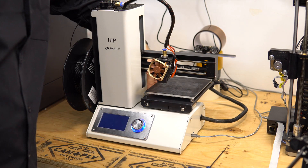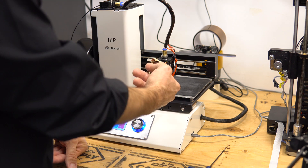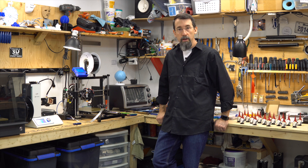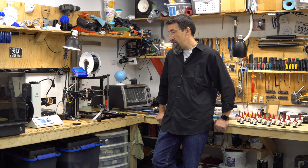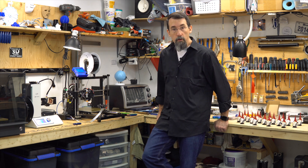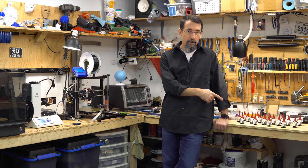Let's try it one last time — 100 degrees. It is noiseless and it makes absolutely no noise. So that's it, guys. I think that's a good modification for this little printer — it makes less noise, so for printing inside it makes sense. It's not that expensive and easy to do. You could also crimp connectors if you don't want to solder. But since this fan is warrantied for five years and has ball bearings, it makes sense to just solder the wires. Happy holidays to you all — thank you, ciao!